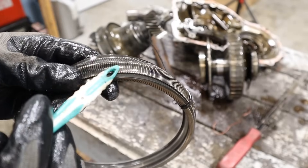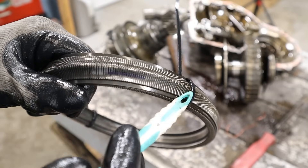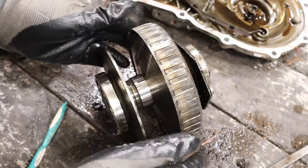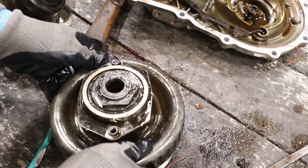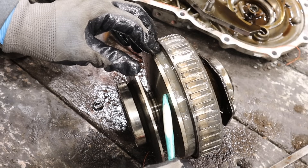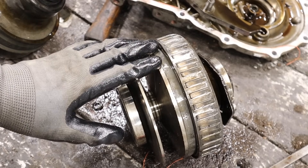Taking a closer look at the CVT belt, you can see it's made up of many different pieces with a profile on them with an edge that's going to match the conical edge on the variators. All of these little pieces are held together with two steel bands that go around the whole belt. It's only the pressure of the variator squeezing them that's holding all of these pieces on that steel band. This here is the primary variator — there's no spring in it, so I can show you how it works. It's basically a giant piston inside of here. If you fill up fluid from the transmission casing inside of here, it's going to push the variators together. Because they have this cone angle, it's going to force that belt to ride from the lower diameter all the way up to the higher diameter. You can vary how much pressure is in here — hence the word continuously variable transmission.